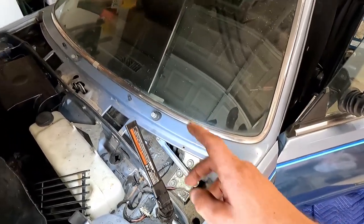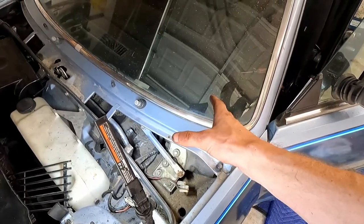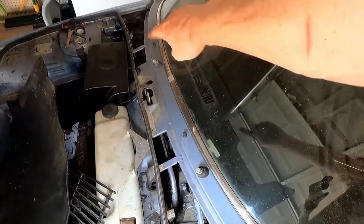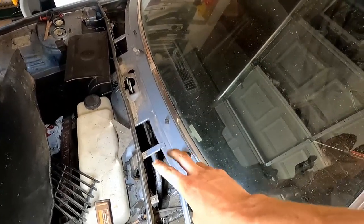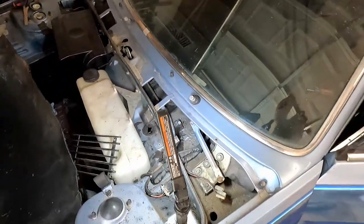I just want to get this fed while we have all of this exposed and do it all at once. So let's install the pedals first, have them hung down, and then we'll come back up, feed the rubber line up through to the reservoir, cut it, and then do the next one, feed it up and through, cut it. There's supposed to be three total, one for the clutch and two for the brakes. Feed those all the way through, reclamp it, and start filling up the system.